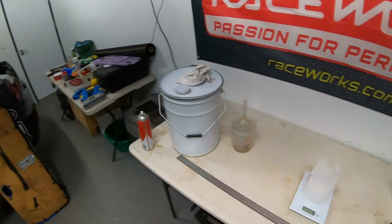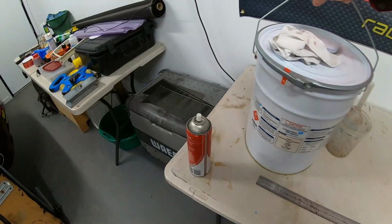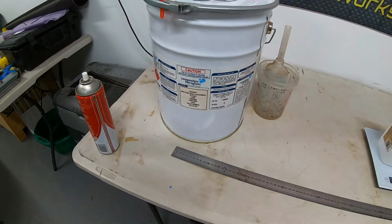So, resin. The expensive part with carbon, from what I've found looking into it, comes from what resin you use. The epoxy resin is dear as poison. It's obviously got its upsides, it's a fair bit stronger, but telling the guys we got it off, they've recommended just a vinyl ester resin. So it's a lot less smelly, a lot easier to use, and it's way cheaper.